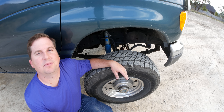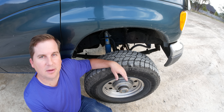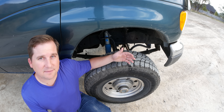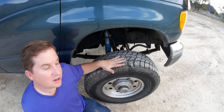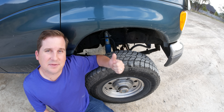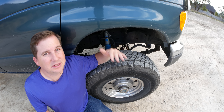From the factory, Fred came with independent front suspension with coil springs in two-wheel drive form. Ford never manufactured these in four-wheel drive, so if you want four-wheel drive, you have to make modifications or send it to a company that will do so. The bad news about having to convert your van to four-wheel drive is you have to lift it considerably. With the big, strong Dana 60 front axle — the solid front axle — it gets in the way when it articulates. So you either have to severely limit up travel, or trim the crossmember and lift it quite a bit.